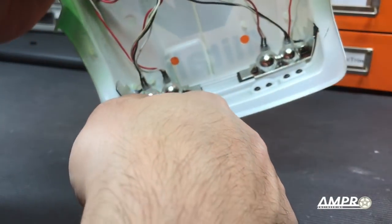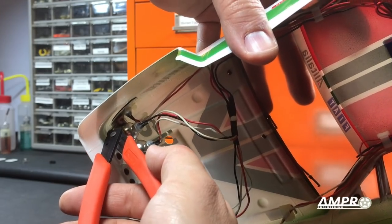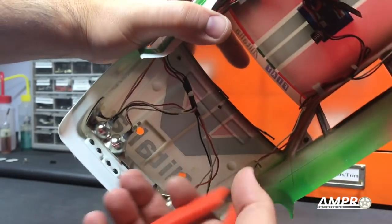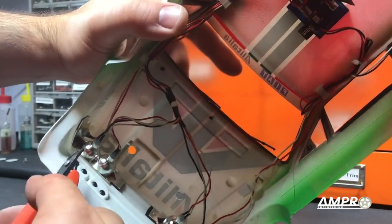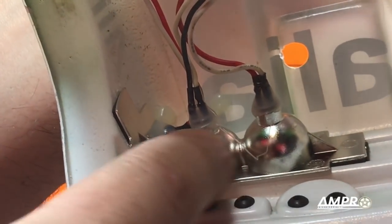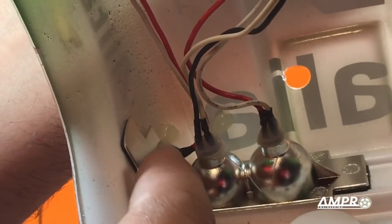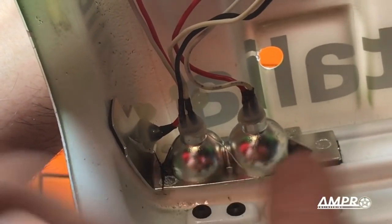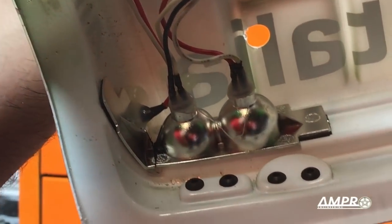So again with the flush cutters, we're just going to snip, being careful not to take out any of the paint. Fortunately, the car is white, so it's easy to touch up. They had molded a small gusset right there which I've cut out. I've got half of this headlight bucket area cut, but I cannot reach the back, so I'll score it lightly with a razor blade, pry this area up, and just bend it back and forth a few times, and hopefully that breaks it loose.